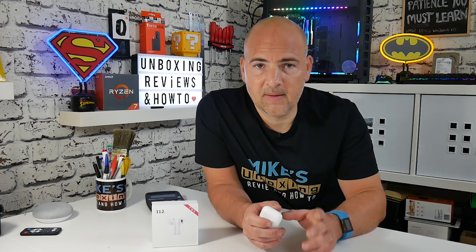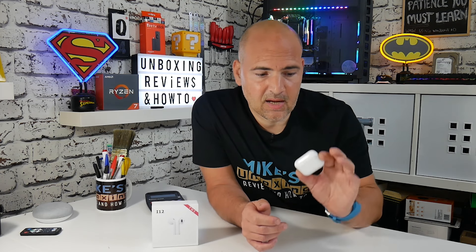First, go to your mobile phone and make sure that the TWS — which is what these show up as in your paired or previously paired devices — is forgotten from your device. This is very important: if that device is nearby and still paired, as soon as you start the process it will immediately fail. So disconnect from any Bluetooth devices and forget them as well.